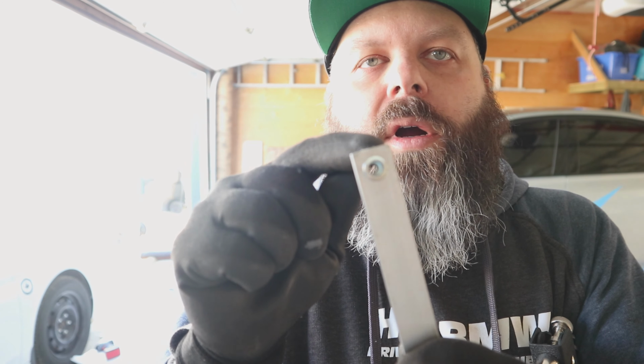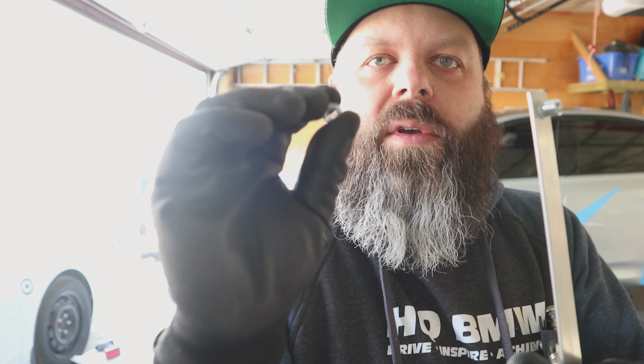So we are going to get under the car, we're going to open up all the holes to the 3/8, put in these riv nuts, get them all squeezed, and then we just bolt the front splitter up. That way if we ever need to change the front splitter or we want to do something different, these fasteners are always there and it's really simple to change. So I'm going to get to squeezing all the riv nuts in there.